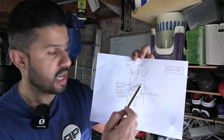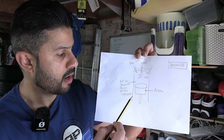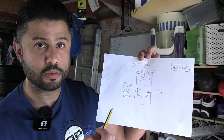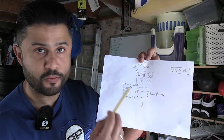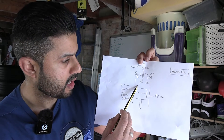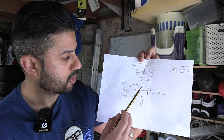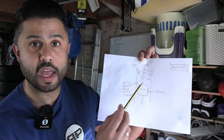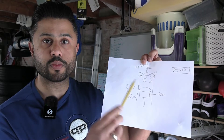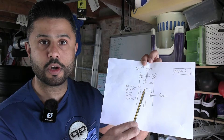That pre-detonation is a random event, and it can actually cause damage to the piston. In terms of what the oil does: if you have oil which is not LSPI-rated oil, then normally formulated oil could cause hot droplets to travel from the piston area into the chamber, and that hot oil droplet can cause an increase in pressure and shock waves which cause damage to the piston ring. So that is my understanding of low speed pre-ignition — having a good oil in there will prevent that from occurring.